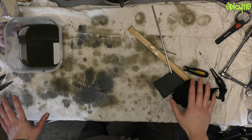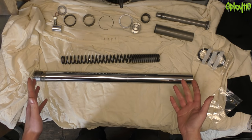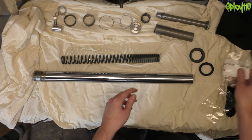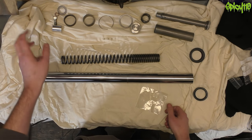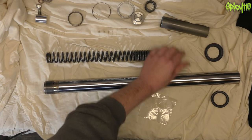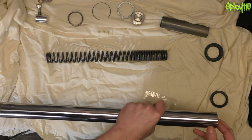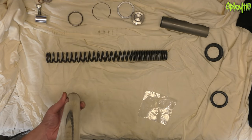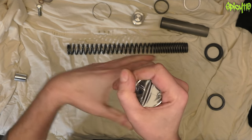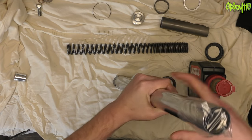Now all the parts are cleaned and wiped down. I need to get rid of all the dirt, put down fresh clean surfaces, and wipe everything over again. We're ready to reassemble — this shouldn't take very long at all. We've got our new dust seal and oil seal. We need a plastic bag over the top of the stanchion to protect the new seals going on. Put the ring over here, then put the spring and the damper together, and put some fork oil all over the seal to increase lubricity and get it to move without catching anywhere.